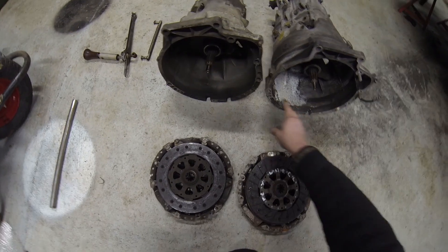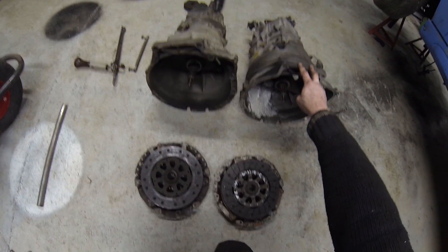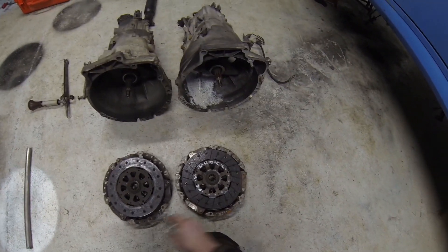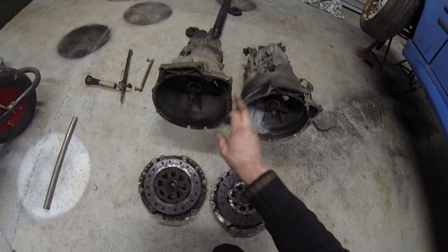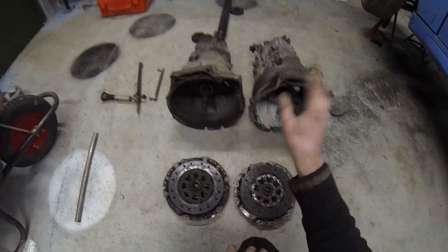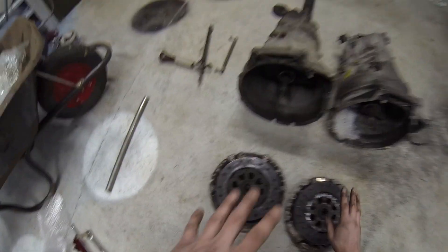There are probably different ratings for different models, but they're the same size so you're fine there. The bolt pattern is exactly the same — these will both bolt up to any M52 or M54 BMW engine. I've had mine attached to a 2.3 M52 and bolted the Getrag box up to an M54, which ended up being a 2.5 — bolted up no problem.